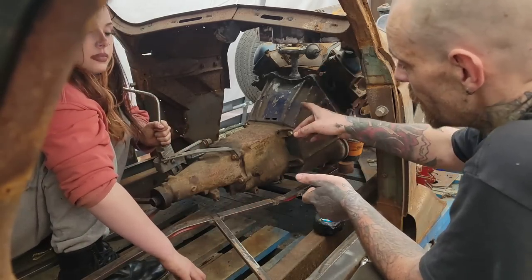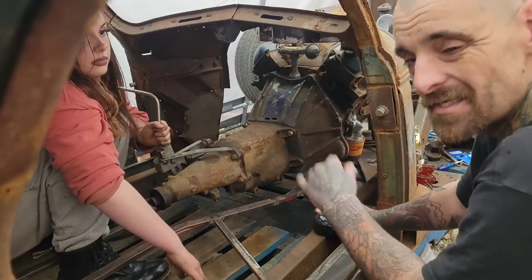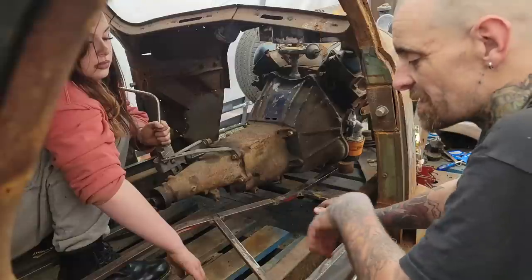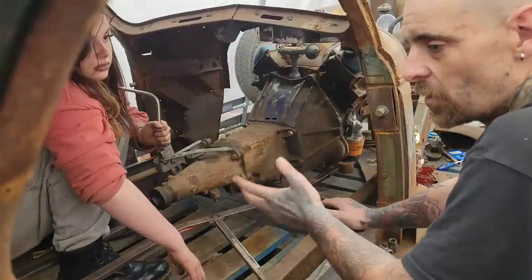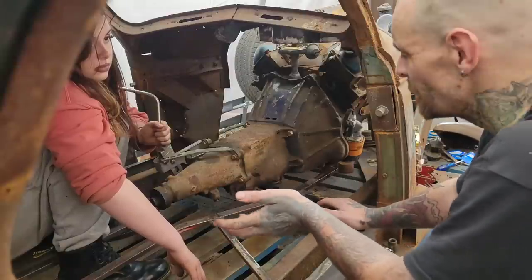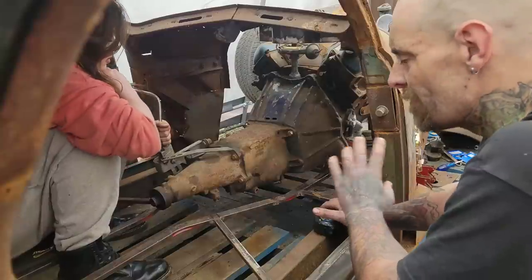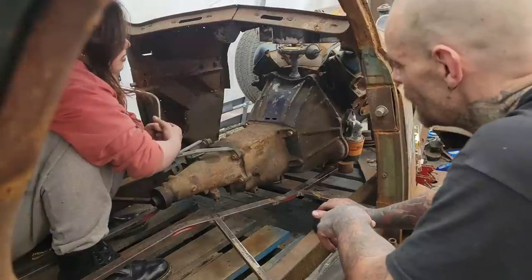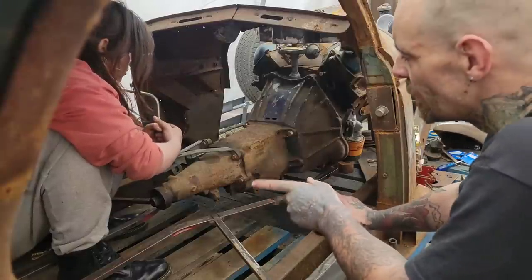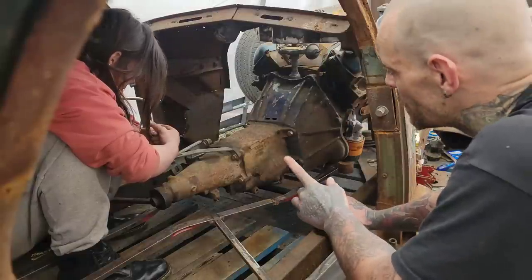The clutch fork that goes with this bell housing looks like it's the exact same fork across 70s Buick, Pontiac, Olds, Chevys. The Chevys, it looks like it's the same clutch fork all the way up to 2000. So I shouldn't have a problem finding a clutch fork for this at all. Might take a little bit of messing around because I'm also going hydraulic at the same time, since I have my racing pedals all drawn up.